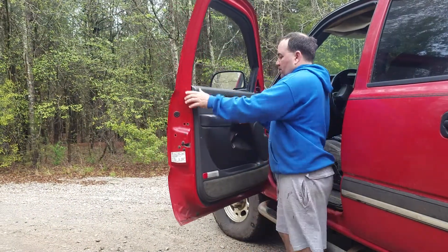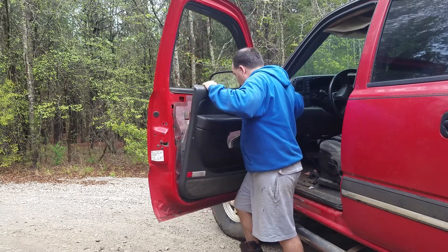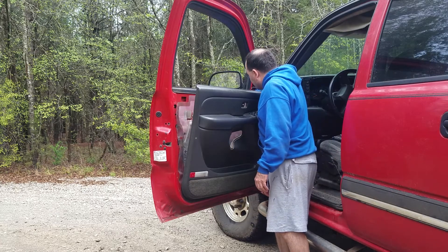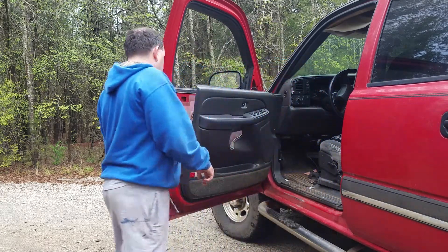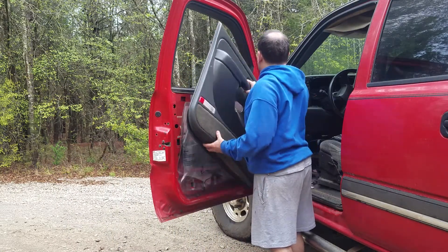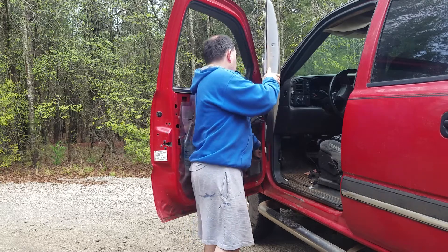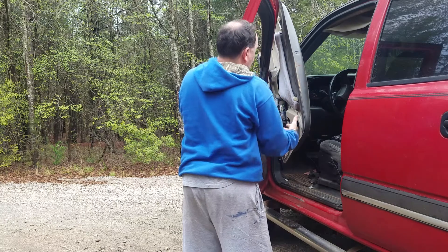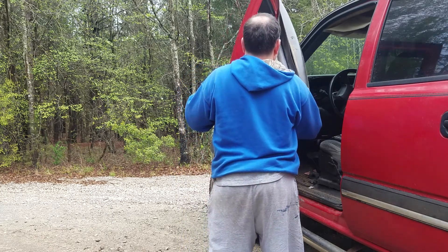So I'm going to take this door panel, pick it up — now it's loose and you can feel the wires back there. You can hang it on its clips and just leave it like that, and this wire comes down and around. You can actually do it without taking the door panel off, but I'm going to take the door panel off to show you how it works. Once you undo this wire right here, reach in and pull it towards the front of the vehicle — that one's out. You can actually take this thing and pivot and rotate it about 180 degrees. Be careful with your wires and it'll actually kind of sit in the door like that. I'm going to show you all these plugs in this door that make it easier for you to take it out if you need to.